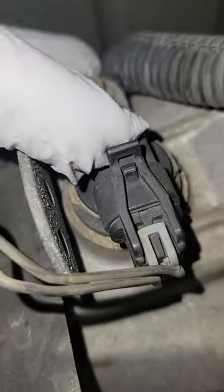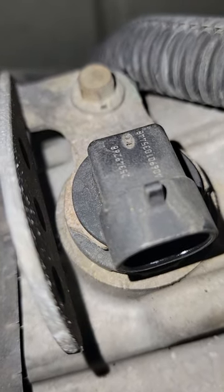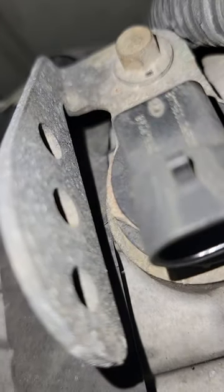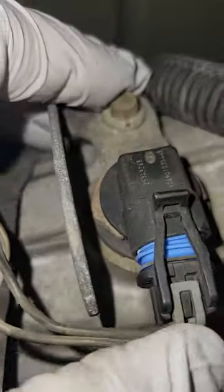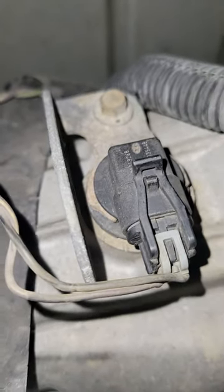It's one of the easier electrical connectors to remove — just pull the little tab and pull it down. Examine the electrical connector for dirt and examine the wiring harness. It uses a 10-millimeter retaining bolt. Remember, before you put your new sensor in, take a dab of fresh transmission fluid and put it around the o-ring seal. When you're done, plug it back in, make sure it locks into place, and just start your vehicle and drive it. That simple.